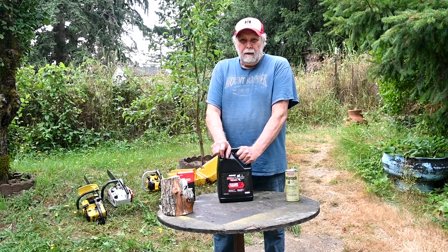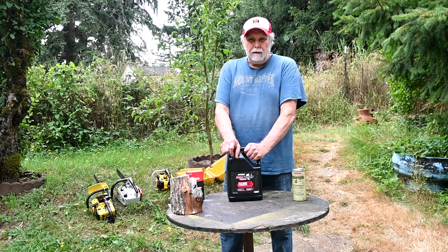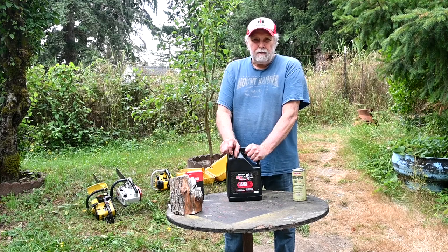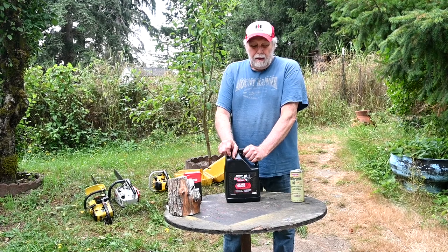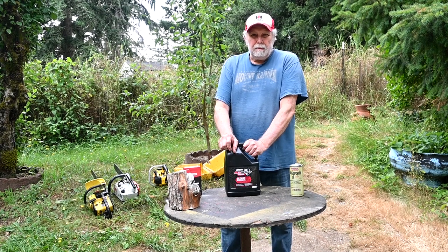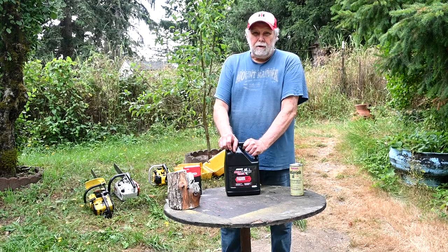Using other brands, I had one that I used some Husqvarna oil, and Husqvarna locked right up on me after I'd been using this in it for a long time. Somebody gave me a gallon of it. Forgot to tell me that's only really good for killing weeds, not for lubrication. And then the Stihl oil too, I used it for a little bit and it was really smoky and built a lot of ash, and the ash is just as detrimental as carbon. And so any of the ester based oils, that's a problem with them. Like in the Amsoil, if you run real thin mixtures, it's not that much of a problem. But if I try to run it in older saws at 30 or 40 to 1, it really builds up the ash bad. So I don't recommend them.